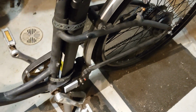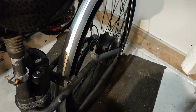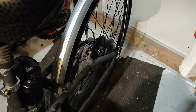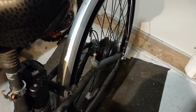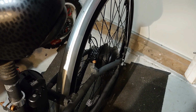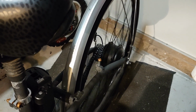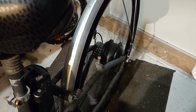I just came from the test drive and it was disappointment. As you can see, the motor is spinning. It makes strange noise, like those gears are broken, but I think they are not broken. That little chip what's burned in the controller, it probably do something important, because like you see now it's spinning nicely, but it has trouble to make that synchronize or something like that.